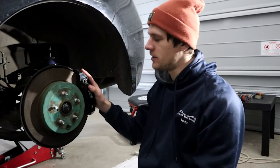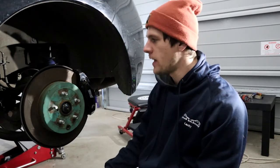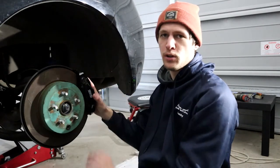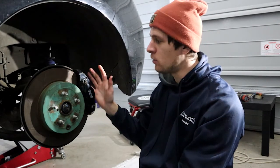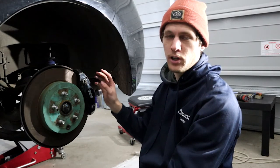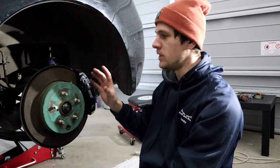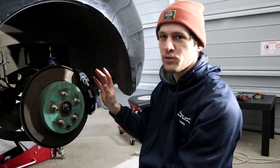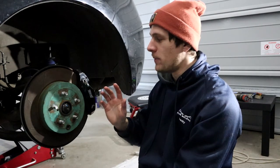Alright, so that's the second Brembo all finished up — brake pads installed, all bolted up. I definitely think it's easier to either leave your caliper bolted to the rotor, or unbolt it and clean it all up. Leaving it in position over the rotor, putting in your brake pads, installing your retaining clip and the pins, and then bolting it up is one of the easiest ways to do this. It literally took maybe 15 minutes with me slowly doing it and filming at the same time, so it's really not that hard.